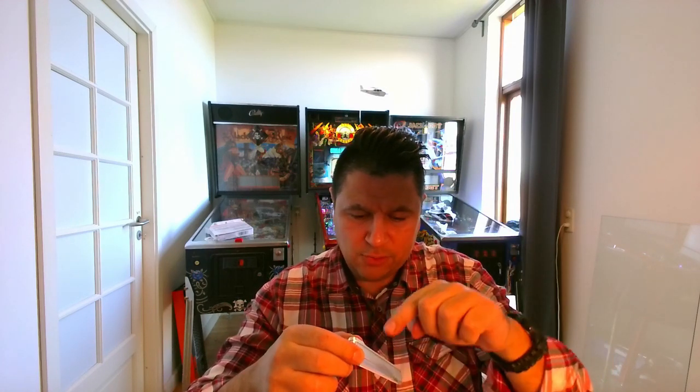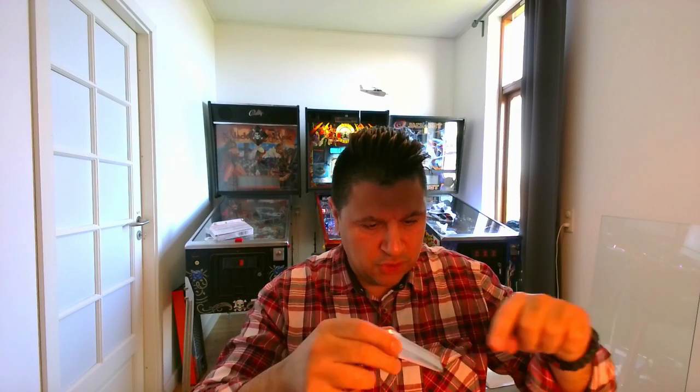I mean, yes, they shoot hard. That's one thing, but if we dissect it and go into details, now it's really nerdy stuff. When your flippers are standing like this, when the ball comes down, bam, and it jumps over to the next flipper. When you have that rubber bushing or plastic bushing, it will give a bit. Every time it gives and the flipper bends down, then you will lose that speed that you need for the ball to ricochet and jump over to the next flipper.